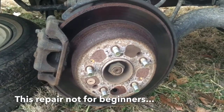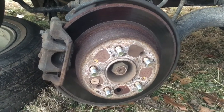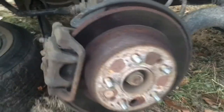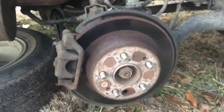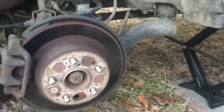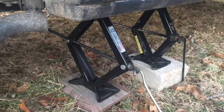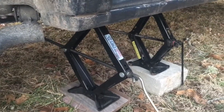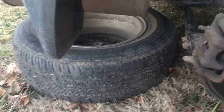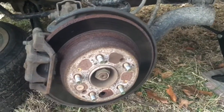In this video I'm going to show you how to replace a brake caliper on a 2004 Honda CR-V or similar Honda vehicle. I've only got a couple things that I'm going to need: some brake parts cleaner, some brake fluid DOT 3, and my jacks. I like to do double jacks — that's just a little bit safer — and also put the wheel under the vehicle just in case the vehicle were to fall. You want to make sure it doesn't fall on you.